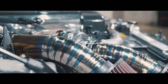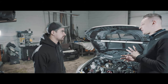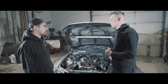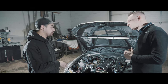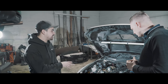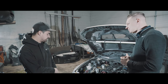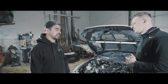I love all the coloring that you've added to the car — it's gonna really stand out. What are some of the challenges you find working with titanium compared to aluminum or stainless? Titanium is definitely a more tricky material to work with, especially welding. Welding it properly with the right heat to get all the right colors through the welds themselves, keeping it clean and polishing it and heat treating it to make it look like this — it's definitely more work than using aluminum or stainless steel. But the aluminum still looks awesome on the bottom and it's a good transition off of the titanium on the top.